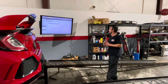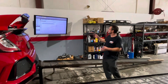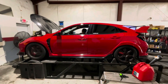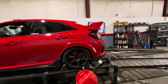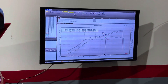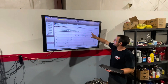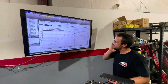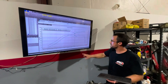At 22 pounds — 22 and a half exactly — made 531. A couple of RPMs were short. I'm going to do some cam timing changes and see how it affects the power in the high RPM. It seems like we can bring some of the power in a little bit. Just by changing some of the cam timing, we can fill this all in while still keeping the same peak power. Definitely going to change some cam timing there.